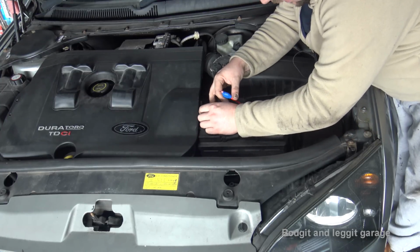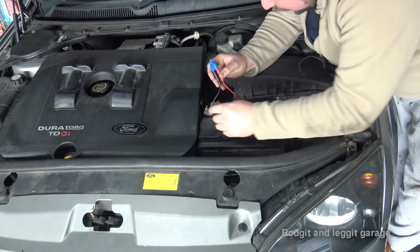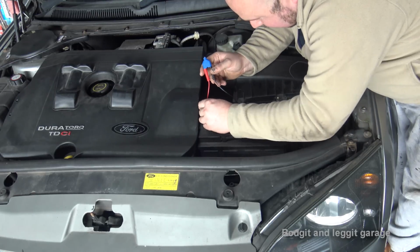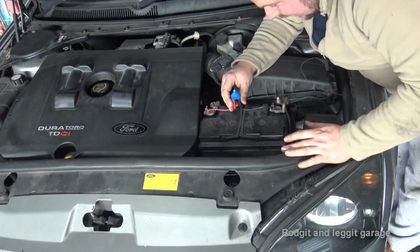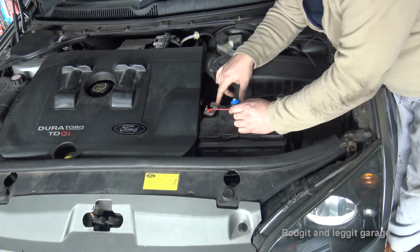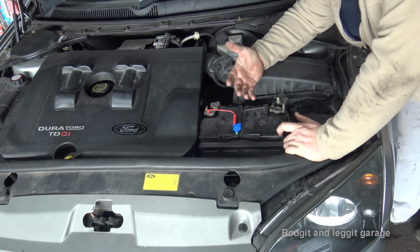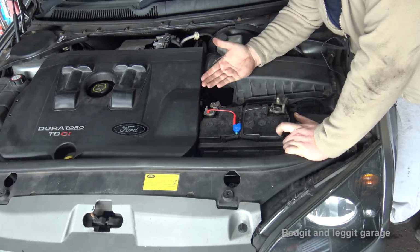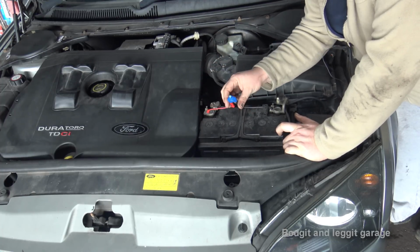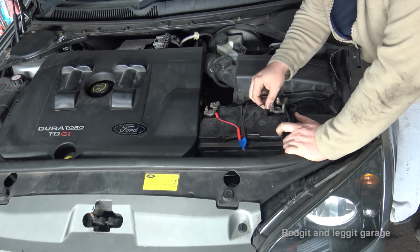As you can see, that's red, so it's telling me the polarities are wrong. So I switch it around, put the red lead on the plus, and there we go. So I now know, without even looking, that this is the plus and this is the minus. Now, obviously on a battery, it's easy. But if you're on a circuit and you're unsure, you know there's a power and you know there's an earth, well, this can tell you very, very quickly, instantly, what they are.